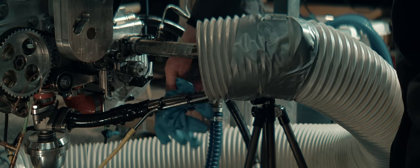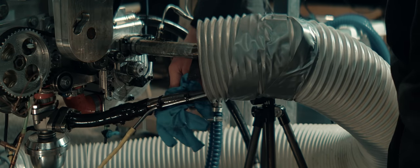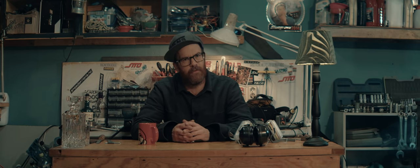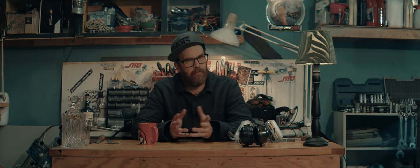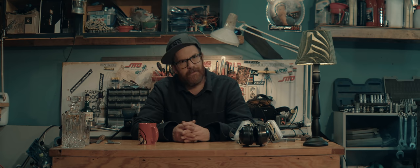Blow-off valve exhaust tube junction broke. Not the worst thing that could happen. We're getting 15 plus horsepower consistently now. It's time to start adding in more boost and less fuel, more timing. See what happens, see what breaks. See what breaks first, fix it, then repeat, and repeat, and repeat, until nothing breaks. And we're winning. See you next time.